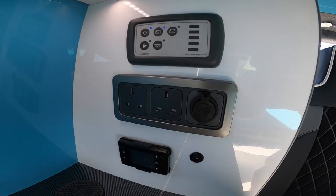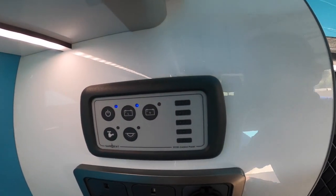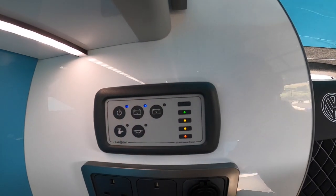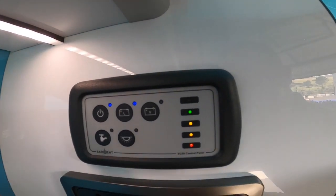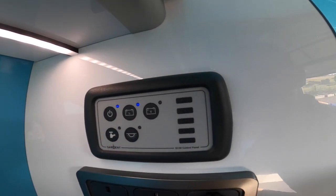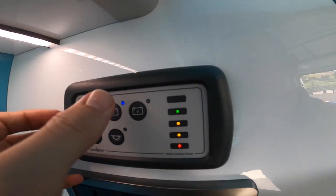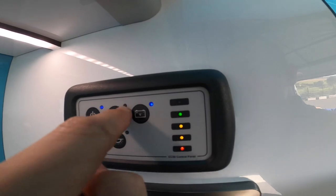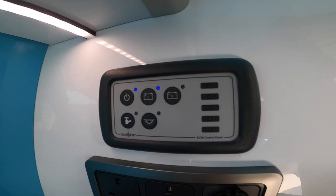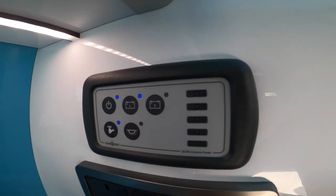Once on board, you've got your main 12-volt control panel. If you're hooked up you'll get mains 240 volt; if not, you'll just get 12 volt off the leisure battery. The master switch is in the top left-hand corner which turns the system on and off. Battery L is the leisure battery and Battery V is the vehicle battery — you always want to be running the camper off the leisure battery. Press them to check levels, and make sure the blue light is on Battery L, otherwise you could flatten the engine battery and not start the vehicle. The pump switch pressurises the tap once you have water on board.